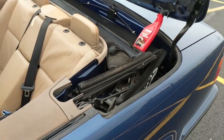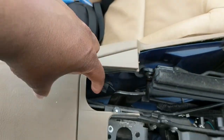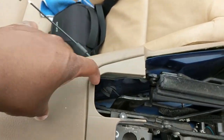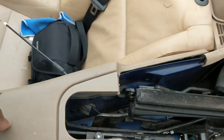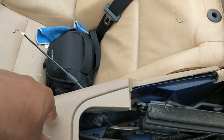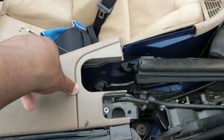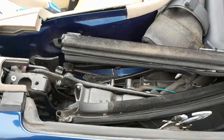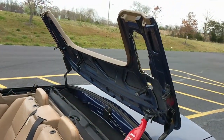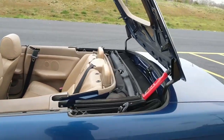And then it's just the same process back, rebolting. Actually, no. When you take these out, don't lose the spacers. Get every single spacer. Count them. Make sure they're right and make sure they're even. And put these spacers back because you're going to need them. Mine was, I think, 10 or 11 on each side. I don't remember exactly, but it was 10 or 11 little metal spacers on each side. Need those. All right, well, that's a quick, rough explanation rundown on how to do a manual swap.